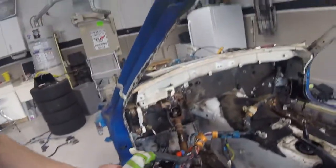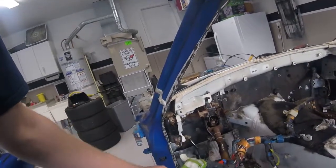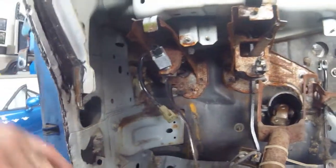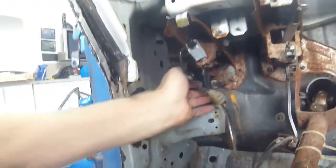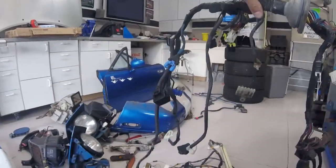I've got the driver side wiring harness pulled in from the hood area. This is the grommet — you can see it's a pretty big hole, right up there behind that insulation. My suggestion would probably be to remove the pedals first — that would have been a smarter idea because there'd be a lot more access room. The interior fuse block sits here; you can remove that and the bracket, which will give you access to pull these wires through. There are quite a few wires that come through from the engine.